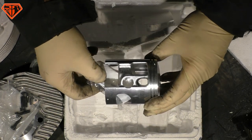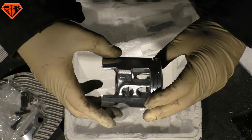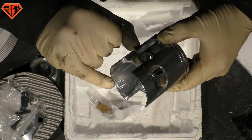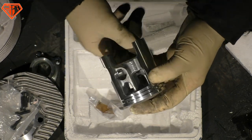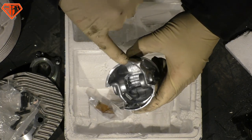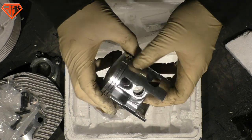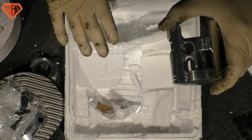And the evolution. Here's the new piston. Look at that. Looks like the ASSO Malossi, the ASSO VERTEX, the Gross Sport piston. And it is from METEOR. So it's a proper producer with a technical design that has proven its stability. Cooling ribs. Both sides of the pin are connected properly to the skirt. We know that they work. Let's compare it to the Gross Sport piston and the ASSO piston.